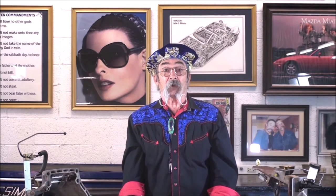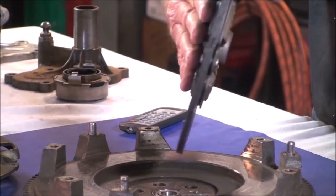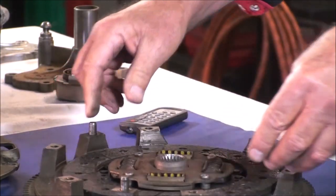Let's get back to the clutch Zen big fail. After you have completed a clutch replacement and go to do the test drive, you may find the clutch disc has been installed upside down and backwards. The clutch disc has a flat side and a side that protrudes and sticks out. The flat side goes towards the flywheel. When installed backwards, the protruding center butts up and locks on the flywheel. There is a simple test to see if this is the case.